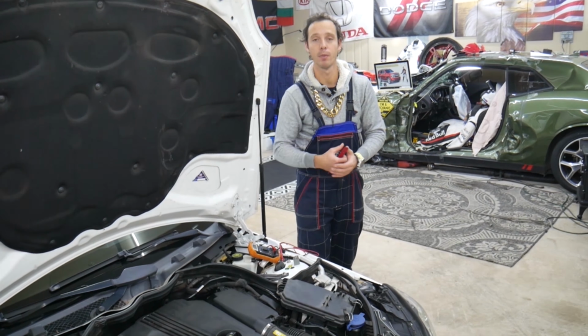So here, we'll be working on the very top of the fuse box. You see that row of fuses right here? The first one is 81, then you go 82, 83. Fuses 83 and 84 will both be for the camera, and those are the ones you will need to check.